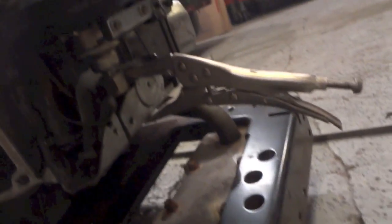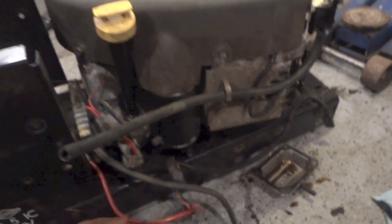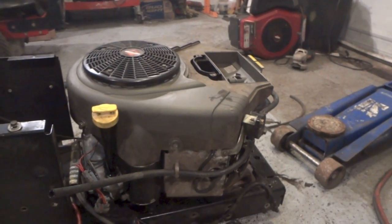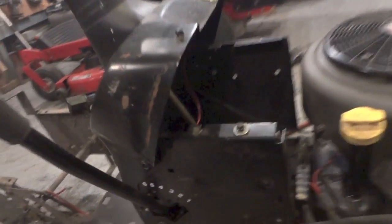I just happened to catch it out of the corner of my eye - I have the throttle wide open and I need to get power to the solenoid. That's the problem. I might be able to get it going with this wire here, but I just can't believe it - the solenoid is the reason it's not firing. It'll pop pop pop, it'll try to run but just won't run. Sure enough it's the solenoid. I guess I'm going to try and fix this mess.